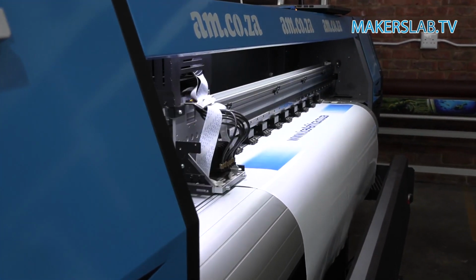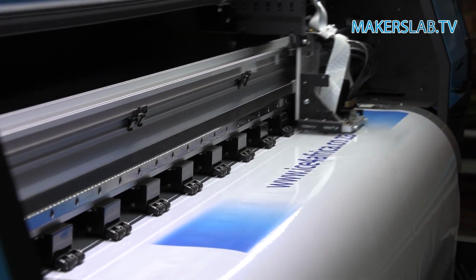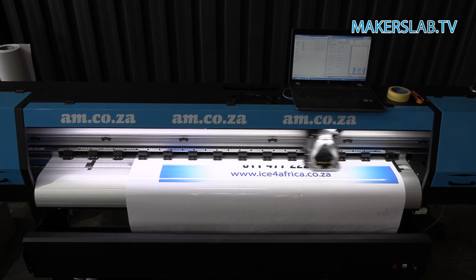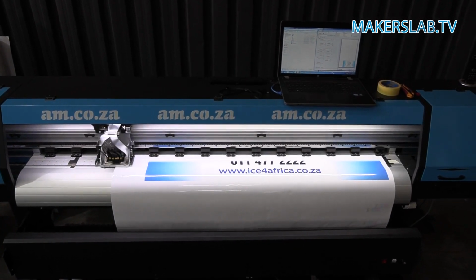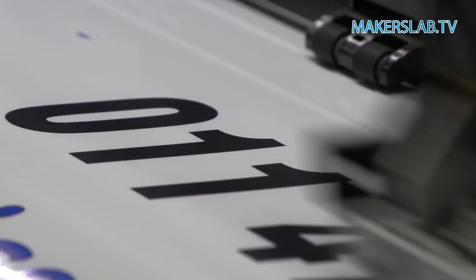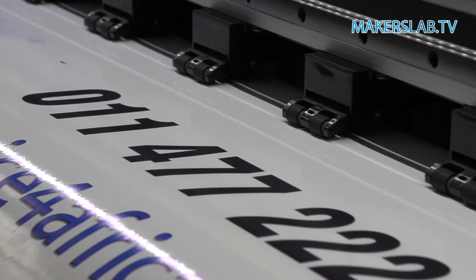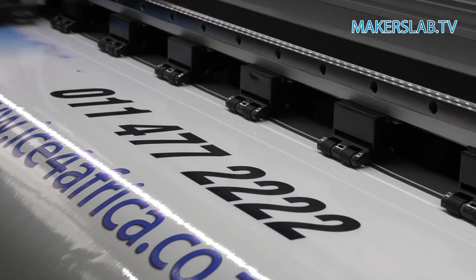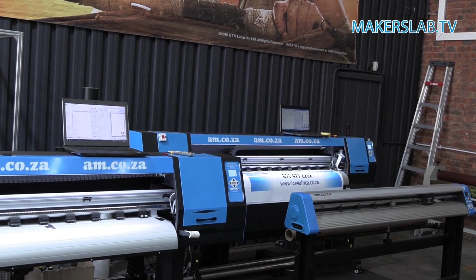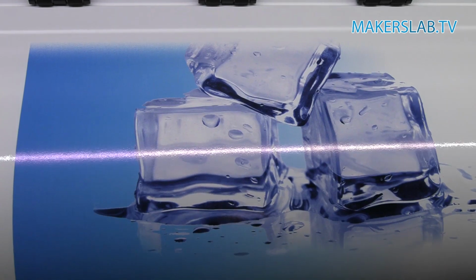Material, I'm going to be using a greyback adhesive, and that's personally my favorite to use, especially when doing vehicles like this where it's damaged. It's no longer just a white piece of metal that we're basically sticking to, or a piece of metal that is our body. There's paint missing, and there's lots of things that aren't necessarily normal in terms of putting vinyl onto a vehicle. So we're going to print on eco solvent.